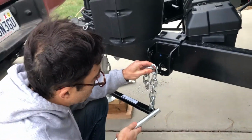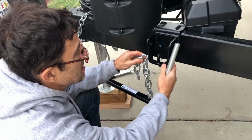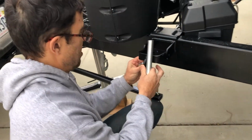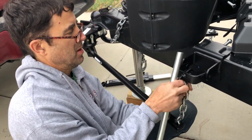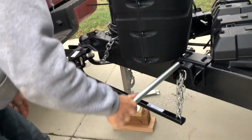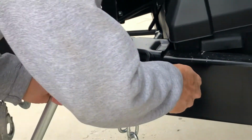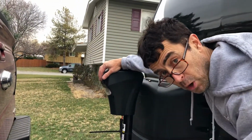Okay, so we're gonna go 1, 2, 3, 4, 5, more than 5 they say, 6, 7, because that's the highest one I can get probably on here. This has a lot of slack in it, so I'm gonna lift it up, put this on, get it up to there, put the pipe on. There we go, so now I got my torsion, get out of the way, all the way up, snap. Got the pin here, goes this one here. Slides right through like that. Now we're gonna let it back down, and it should create tension on the bars.